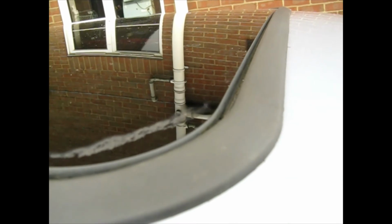Feed the sunroof in, make sure it settles in exactly the right position, and then do up the internal bracketry. Once the bracketry is all tightened up, refit the head lining and all the trim, etc. Notice that at the moment I haven't fitted the sun blinds or the handles, because I've literally just put the sunroof back in and just put the head lining back up, but it's just a matter of reversing what you did to take it out.